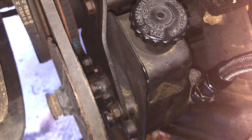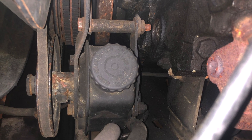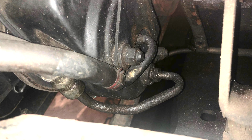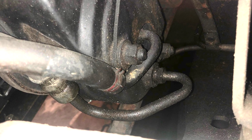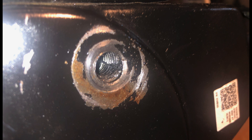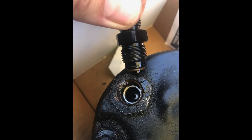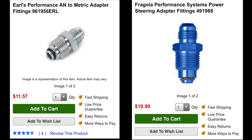You can reuse the stock pump and avoid removing it, but keep in mind it's now responsible for powering not only the power steering but the hydraulic brakes too, so it best be in top shape. This one was torched anyway, so I replaced it with one having a slightly longer return line for adding a 6AN compression fitting. A common mistake is in removing the bracket stud on the back of the pump — not only does this mount the pump, it seals the reservoir and is reverse thread, which accidentally cracks the inner pump housing if tightened rather than loosened.